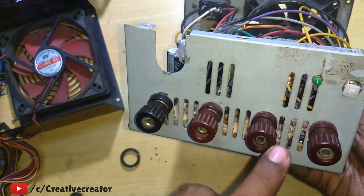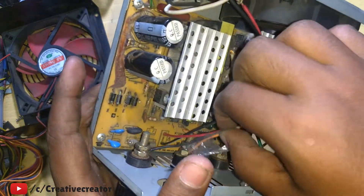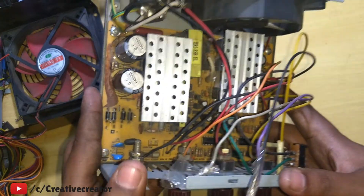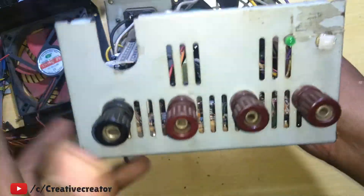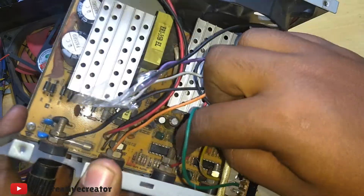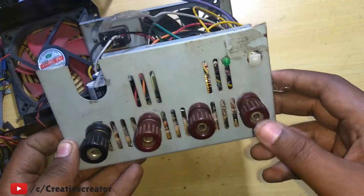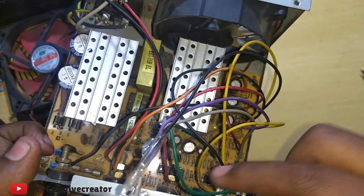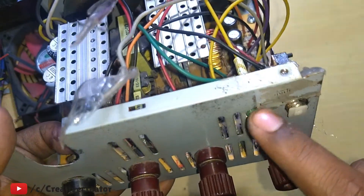As I mentioned, to power on the PSU we short the green wire to ground. I have four banana connectors mounted in a box, separated at equal distances for easy use. The black connector is the negative ground, labeled GND. The red-orange connector is the 3.3-volt output, the red connector is 5 volts labeled on the board, and the corner one is the 12-volt rail with the yellow wire, labeled +12V. I've also added a switch — the green wire and a black wire go to it so you can turn the SMPS on and off.